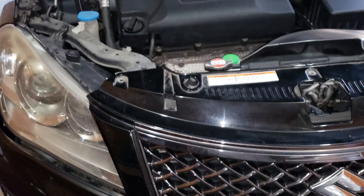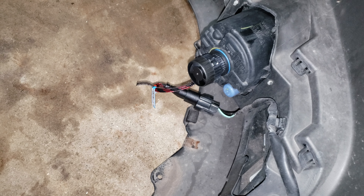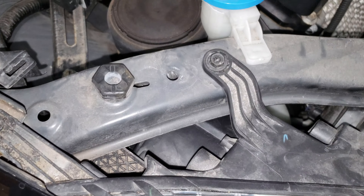There's that little clip right there. Once you get the other side done, you just give the bumper a quick little tug and it comes right off. Same thing with the driver's side — pops right off, gets loose on the bottom. After shimmying with both hands, you're going to take this bumper off and lift it up over the hood latch. On both sides of the headlight housing there are two clips — you're going to want to remove these before you put the bumper on the ground. You do not want to break anything. Once you get those clips out, the bumper is able to go free.